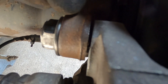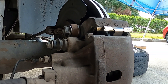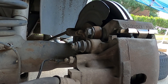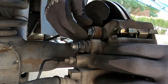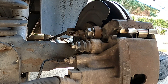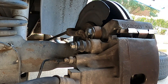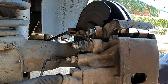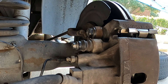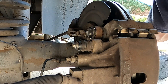We removed the washers. Here are the two washers I had — they were in between the caliper mounting bracket and the bracket on the rear end. Now that they're off, I'm gonna bolt the caliper back up without the washers and show you. See, the rotor spins freely right now. But watch — I'm gonna bolt this thing up and look how hard it is to turn.